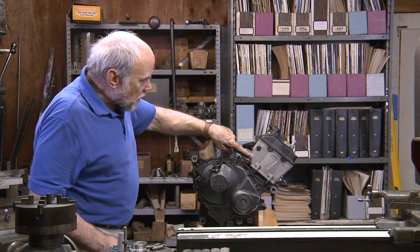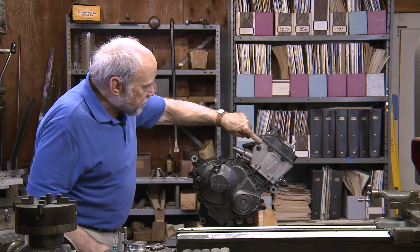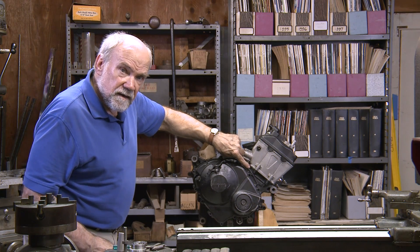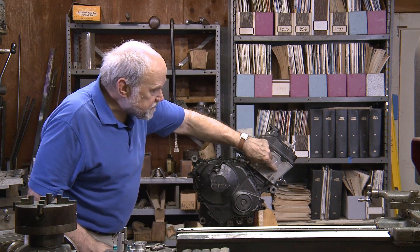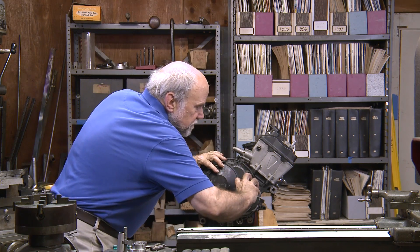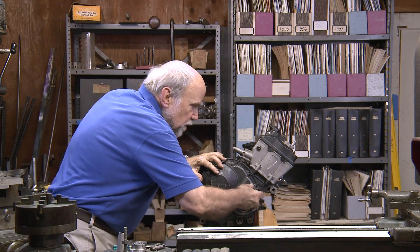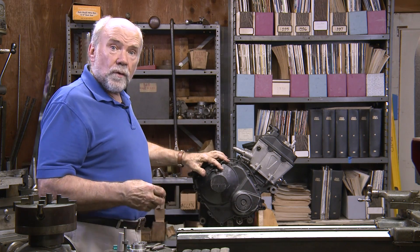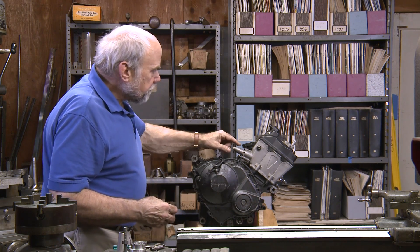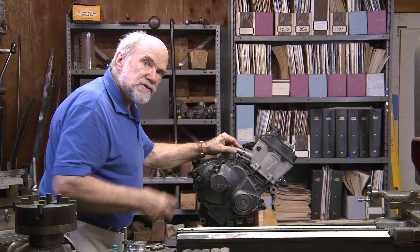The fact that this tensioner is on the back of the engine rather than the front indicates that this run of the cam drive chain is slack, and this run is the one that's doing the work — it's tight. That means the engine is turning this way, the same direction as the wheels. We call that a forward rotating engine. A cam tensioner on the back of the cylinder means a forward rotating engine.